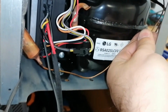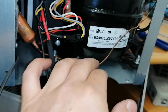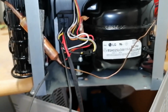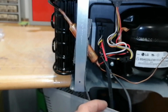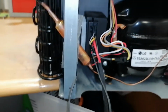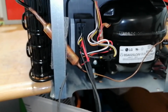Okay, also I will have to arrange these capillaries here in a way that it's not touching anything, so it won't rub in time and have any problems. Okay, I also have to change these wires because I have to go under. Yeah, that's no problem. Okay, so I will put everything back together and leave the cooler running.